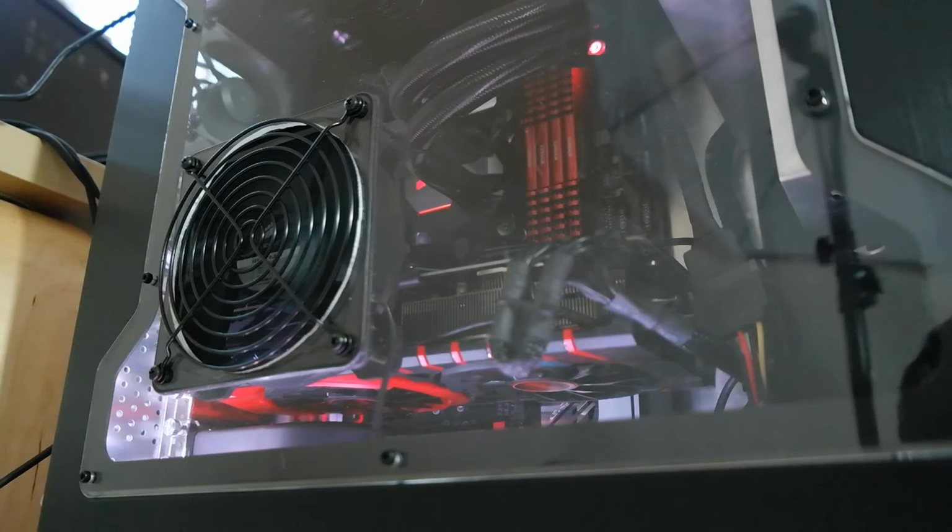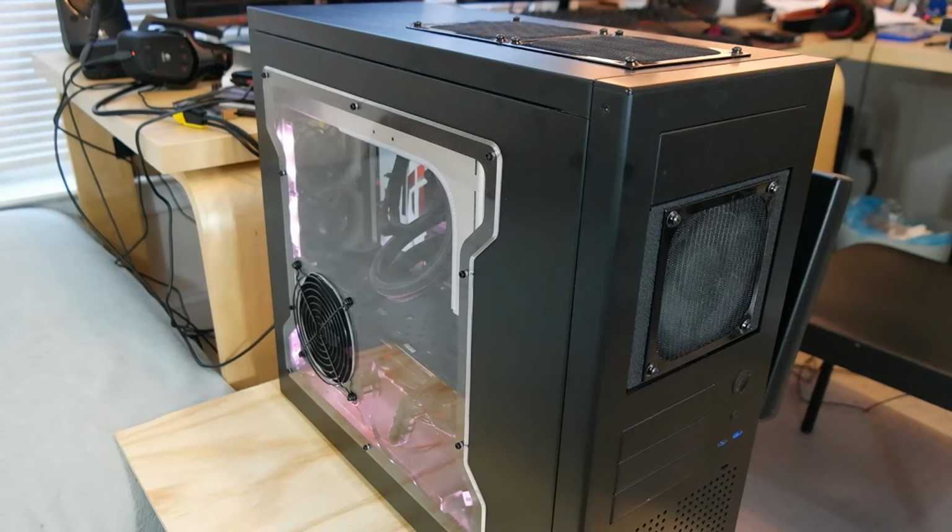Now, for real-world examples, I mean, FurMark is really burning in your graphics card. It even warns you before you run the test that this is very graphics-intensive, warning you could damage your equipment. More real-world-wise, what video games have I been playing? Well, I showed before using Dying Light, I was hitting 88 degrees Celsius in this video, but I could thermally throttle it up to 93 degrees Celsius playing Dying Light, no problem.